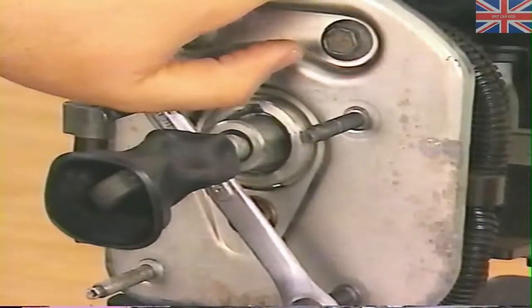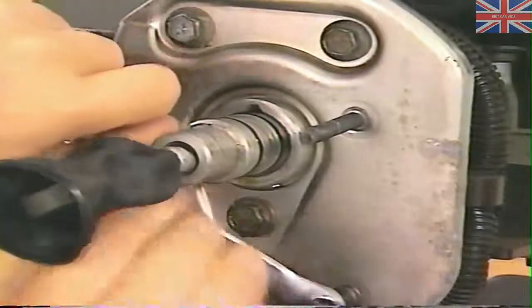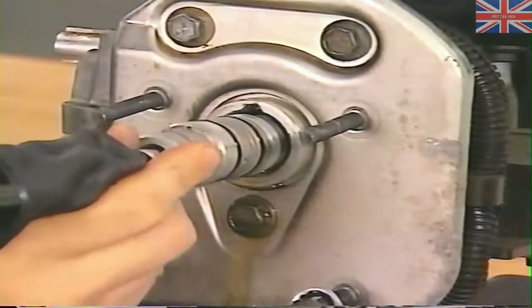Now slowly release the wrench from the input rod bearing. This will allow the primary piston assembly to pop out of the actuator bore. Any fluid from the actuator bore should be caught in a suitable container.